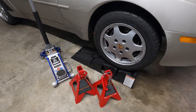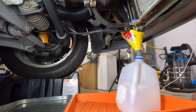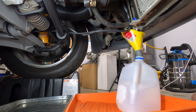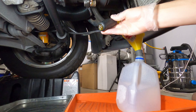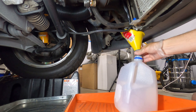To begin draining the coolant, you'll first need to raise the front of the car and remove the lower splash guard. I also have the cooling fan assembly removed for easier access, and a couple of catch pans laid out. You can use a drop cloth or some cardboard boxes to catch any of the oversplash. The drain plug is located on the lower driver side of the radiator and comes out with a Phillips head screwdriver. I like to try to catch some of the fluid as it escapes just to make cleanup a little bit easier.